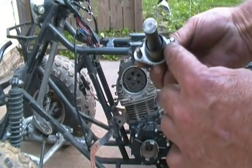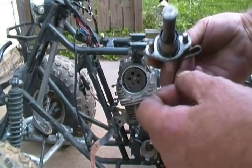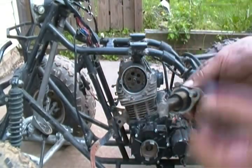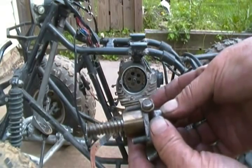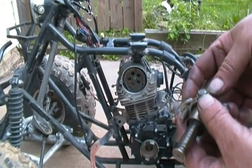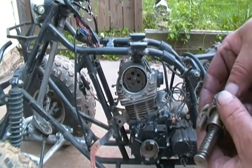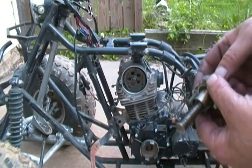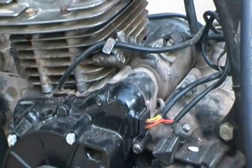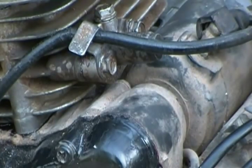There's an O-ring in there, so I'm going to replace that while I'm at it — trying to keep this thing leak free. I've got my head bolts all torqued down already. The big ones are 18 foot-pounds and the small ones were 87 inch-pounds, just so you know. I got my tensioner in — you can see it there.